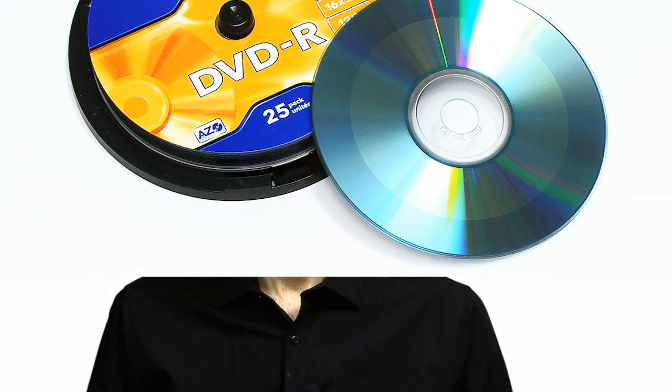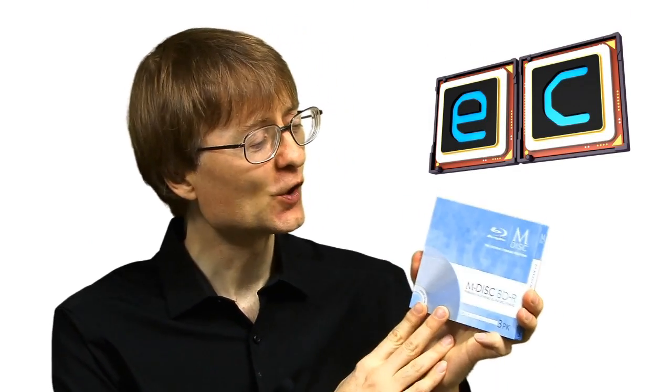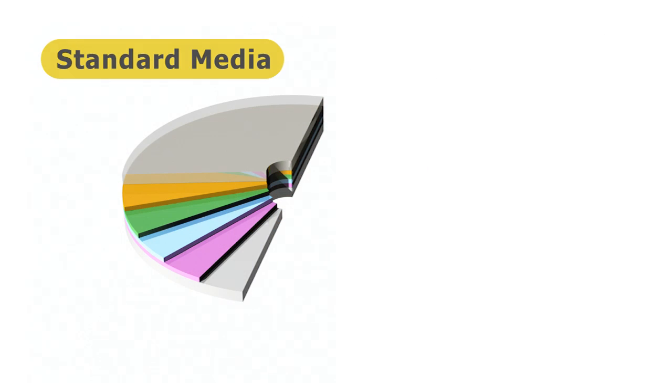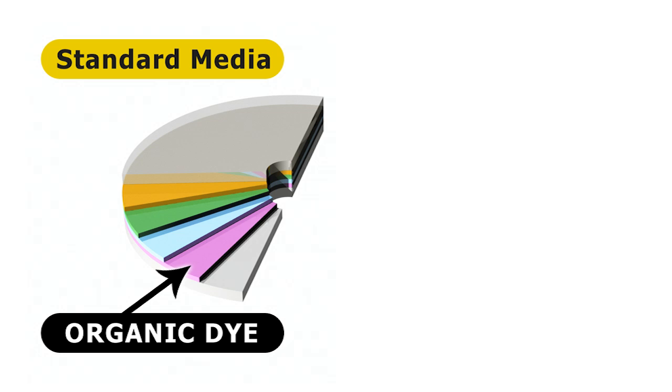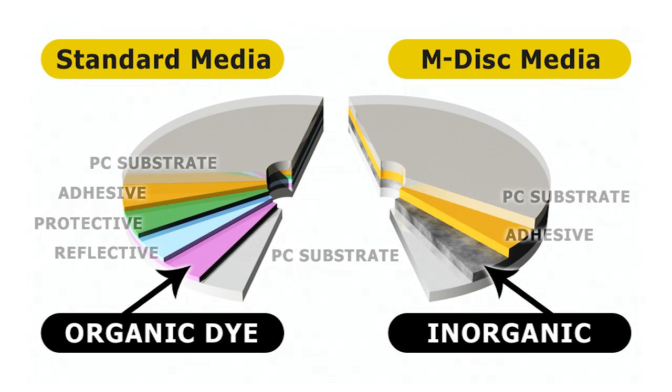As you may know, traditional DVD, Blu-ray, and CD discs — if you write data to them, it can be gone in a few years, or even a few months if you're unlucky and they aren't particularly good discs. But with M-Disc, the data is supposed to be secure on the disc once written for centuries, if not a thousand years. Traditional writable media store data using an organic dye whose properties are changed by a laser, and that dye can degenerate over time. With M-Disc, your data is stored using an inorganic, what they call rock-like layer into which the data is engraved, and that's supposed to have much greater longevity.